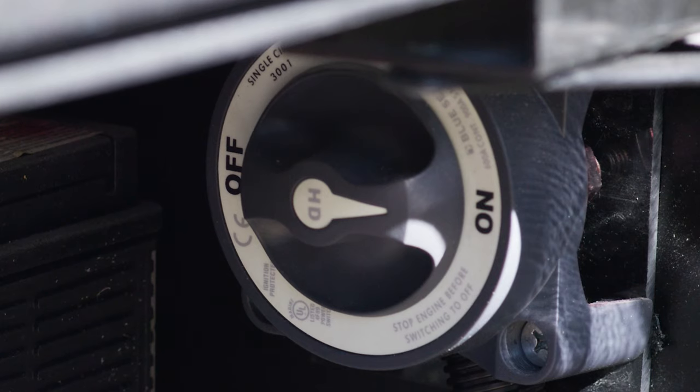What your inverter is going to do is take all of your DC power and turn it into AC power. That way you can turn on your inverter while driving down the road and fire up your refrigerator or your television. It is connected to certain outlets, and you can get that schematic through our owner's resources page on ThorMotorCoach.com. Now take note that when you have your inverter on, it is going to use juice from the batteries and you can drain those batteries. But we have an auto gen start feature on the Rapid Camp Plus — when the voltage gets too low, your generator will fire up, charge your batteries, and they won't die.